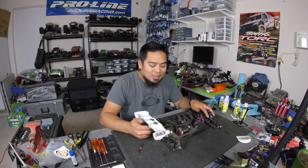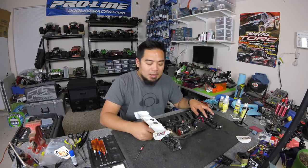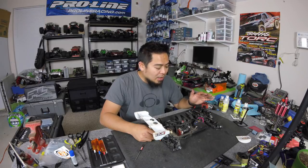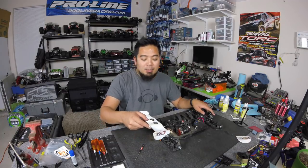Alright guys, all done. I put my diff back in, ended up replacing one of the bleeder caps — I noticed a little bit of oil leaking out, and I had cross-threaded one of the bleeder screws unfortunately. But I put my diff back in, replaced my drive shafts and dog bones, and this car is actually ready to go. It's been my club racing car and the only thing I really needed to do was replace that rear diff. So this one's ready for the Icebreaker. If you like this video please like and subscribe, and tomorrow we work on my nitro buggy — see you then!